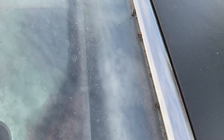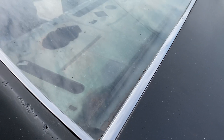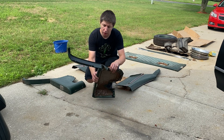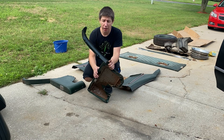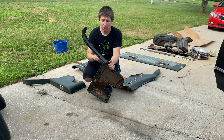Let's take a look and see how it looks — well, it's black, but I do have a lot of rust still that I didn't get, tucked way back up in there. It's kind of hard to paint all the way back into there with the glass still in, but it's better. Luckily the window is still fogged and faded and that can hide some of this, but at least it's painted black to protect it a little bit longer. Now for the rear deck lid — one thing I want to focus on first so it has time to dry is these rear metal trim pieces that go up the back of the back seat. They're just held into the armrests by two screws — we'll take those out, sand them down, and hit them with some epoxy paint to make sure they go right to black.